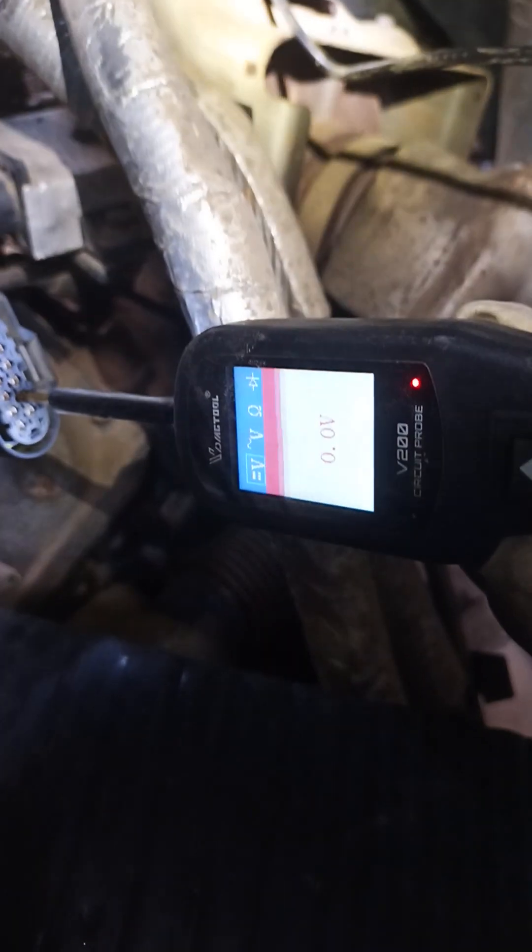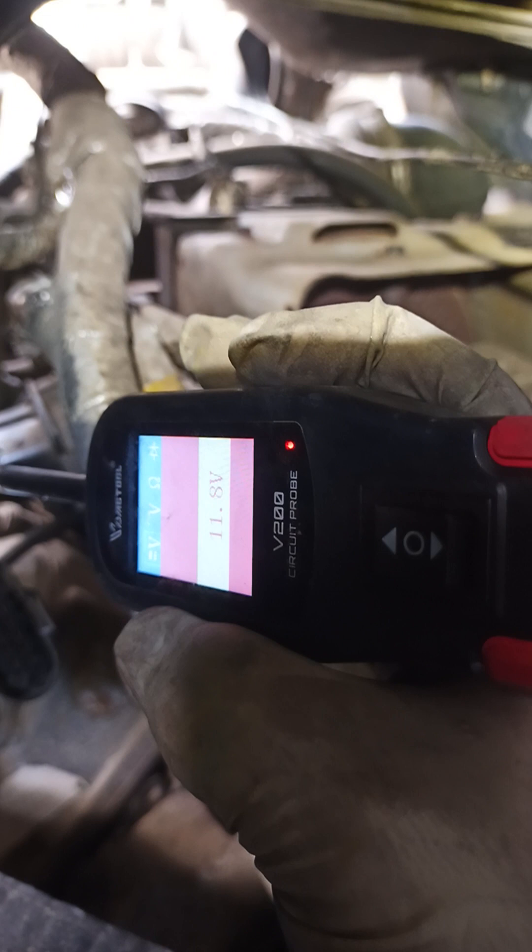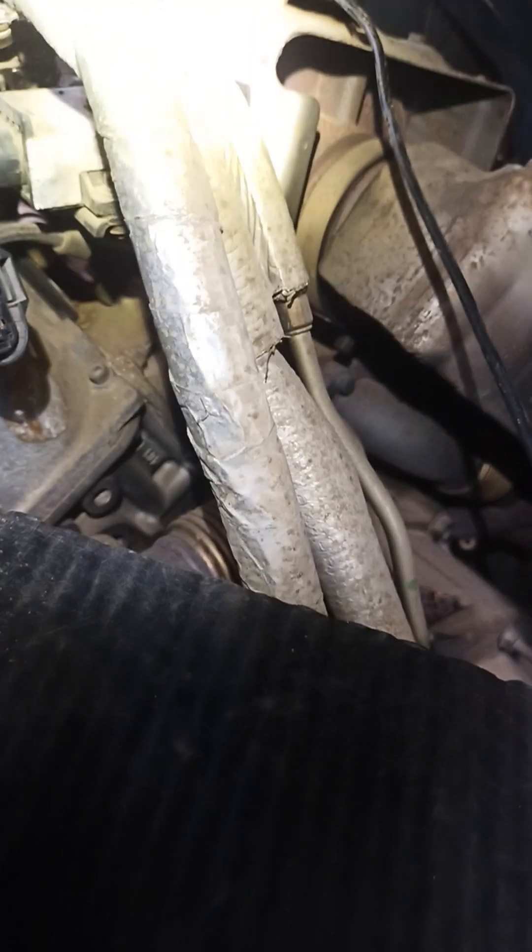Pin five is positive and the second pin is ground. Once you've checked that, this main wire right here should have 12 volts — and you can see it has 12 volts. There we go. That tells us that module has failed.